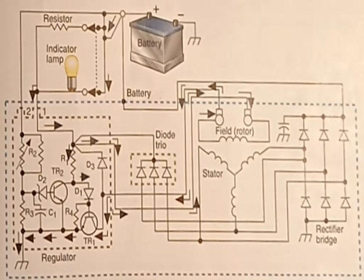The alternator number two terminal is connected to the positive battery terminal; therefore, alternator voltage is sensed at this terminal when the engine is running. When the alternator voltage reaches a predetermined value, TR2 in the voltage regulator is turned on and TR1 is turned off. The regulator typically limits the alternator voltage to between 13.8 volts and 14.8 volts.